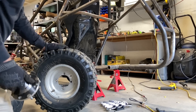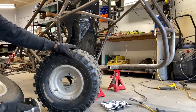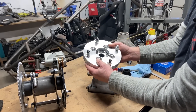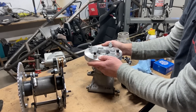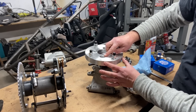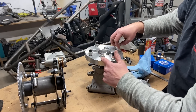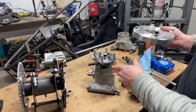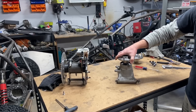This is the moment you'll be extremely happy or fighting mad - I am extremely happy. Look at that, that's perfect, and that's how it's done. Alternatively you could get hub adapters, but that makes your buggy wider - which if you're looking for wide, not such a bad thing - but it adds extra weight and the studs usually poke out. Going from M12 to M10 on a spacer is highly specialized and expensive. For example, a 4x100 to 4x156 one-inch spacer - that's how you do it that way. I prefer this method.